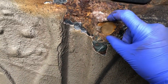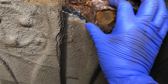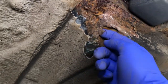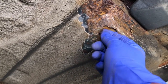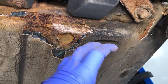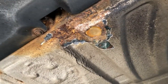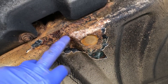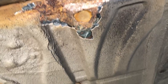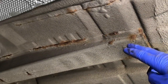These floor pan grommet areas were 25mm natural grommet holes that BMW installed on both sides. The grommet's probably not been there for a while because the metal — the floor pan of the vehicle — is that soft I'm moving it with my hand. If some of the floor pan is that soft and you were to have a side impact, knowing there is corrosion of similar nature elsewhere, there is more chance the car is actually going to suffer a buckling issue where it probably wasn't designed to. Surface corrosion isn't the end of the world if it can be removed and neutralised — but it's the trapped corrosion which is the biggest problem on all vehicles.